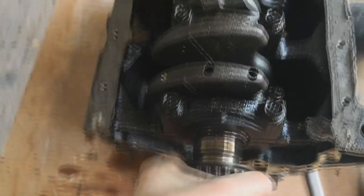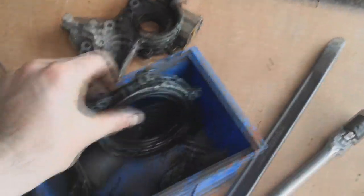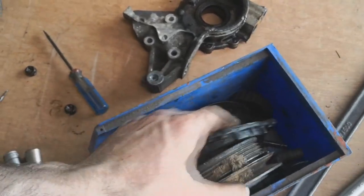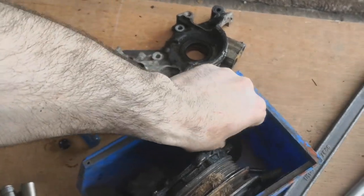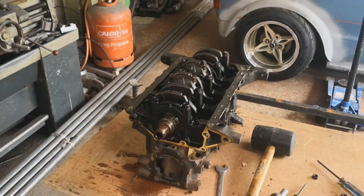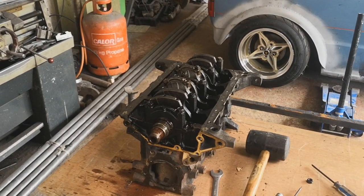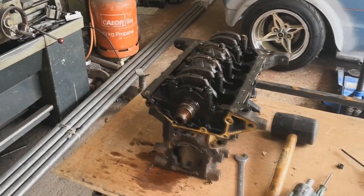which gives you ever-changing timing on the belt, and then the engine won't run properly, obviously. But I've only had one car that I had a problem with a short nose crank, and I bought it with the problem, and I just put a long nose crank in the engine.